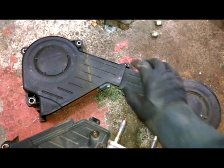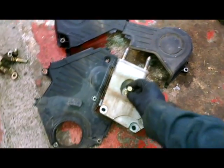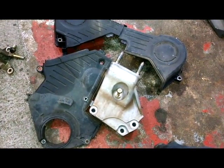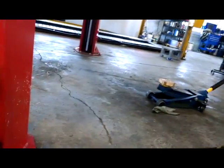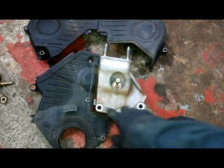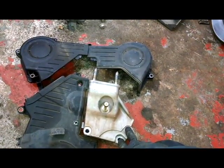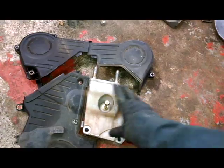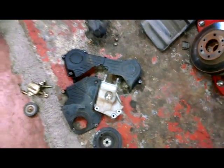Like so. Tabs here. And then these 1, 2, 3, 4 bolts here. This one stays in. When you let the engine hang down, it'll hang down about 3 inches. You can get these bolts out, no problem. Then you need to jack the engine up. Then you can get this bolt and this bracket assembly out through the top. That's basically where we're at.